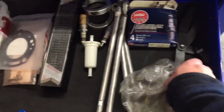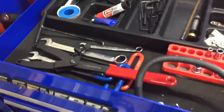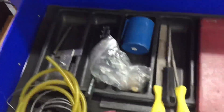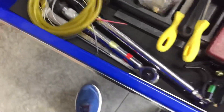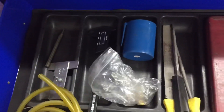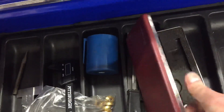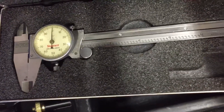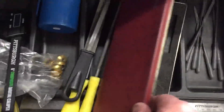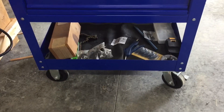Just miscellaneous things you might need. This crank sprocket gripper will probably just get moved right up top — that's what you grip the crank sprocket with when you're trying to loosen it up. Down at the very bottom is just miscellaneous things you need to have: a little extra fuel line, extra clutch cable, torque wrenches, a float bowl tool for the L206 which I may not need this year, safety wire, calipers. These are cheap inexpensive calipers for getting a quick metric measurement. I've also got a really nice set of Starrett dial calipers that are pretty awesome — picked them up for about 20 bucks back when I was in the tool trade. Files and things like that. What's down there stays — those are things that just need a place to ride along that you may or may not need, but you do need to have them at the racetrack just in case.